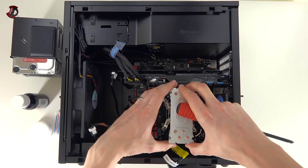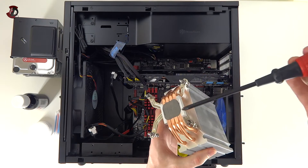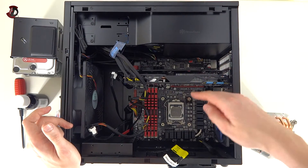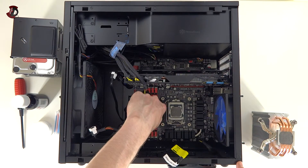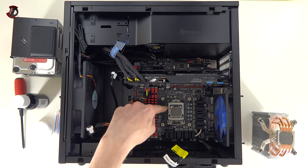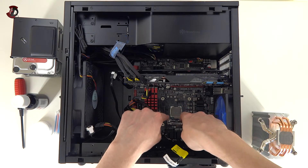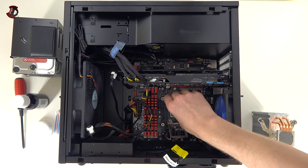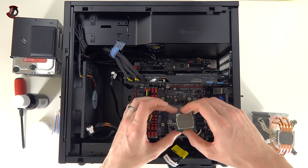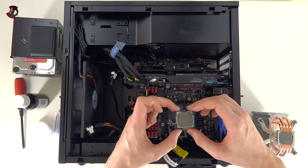Now that everything is loose, I wouldn't advise you to just pull it out — wiggle it a bit and then it just comes off. When you're putting it down, twist it around because you have lots of thermal paste on there, then put it aside. To remove the CPU, push this retention bracket down, push it to the side, and release it. Keep pushing it that way, that lifts the mechanism up, and then you release the whole thing — and this is your CPU. This is a good reason to ground yourself before touching it.